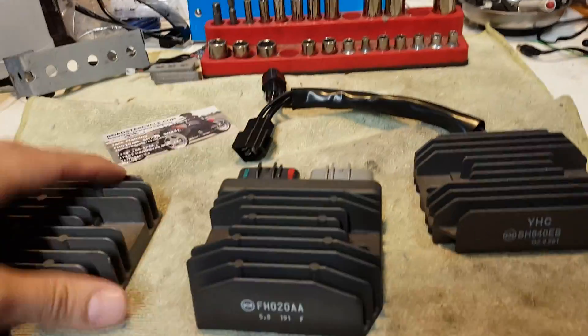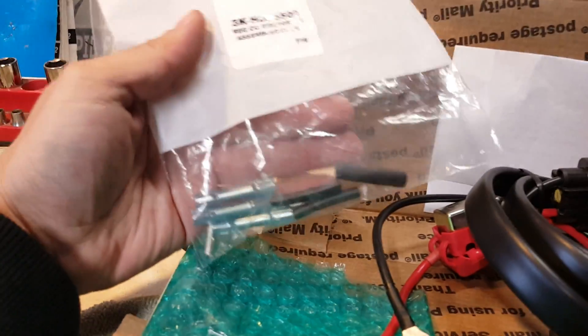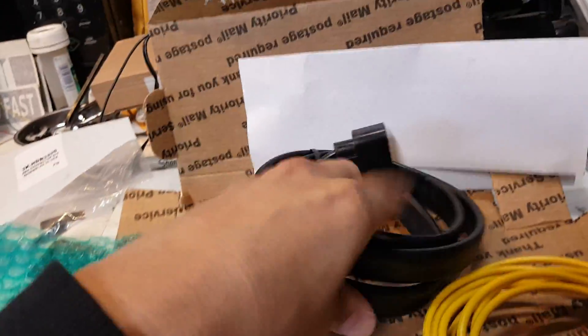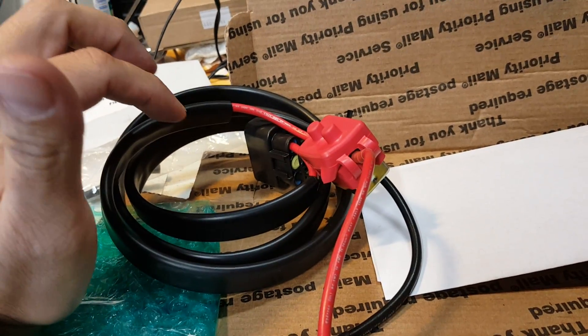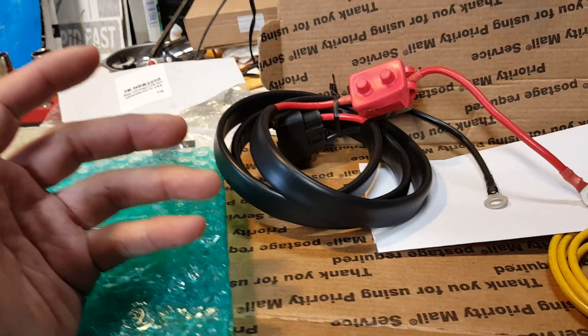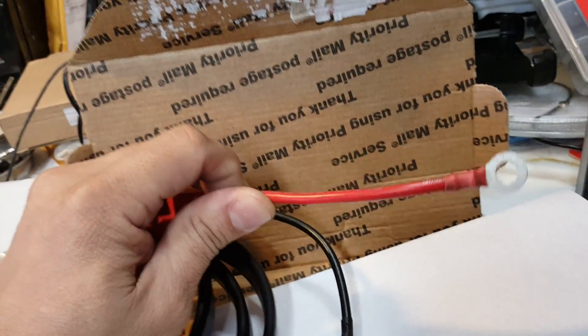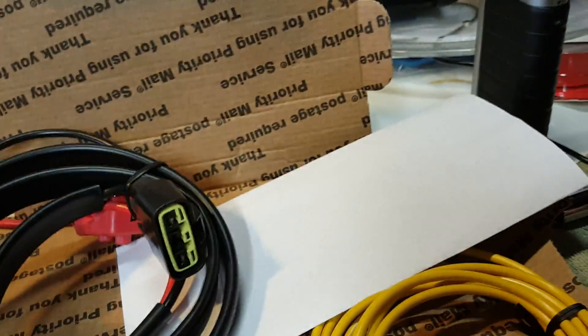With a little more money you get a little better quality, and hopefully the same holds true for the internals. Looking at the super kit contents: you get a package of crimp connections, solder-in connections, and heat shrink. The unit comes wrapped in bubble wrap for protection. The cabling quality is excellent — it's 12 gauge wiring. I had previously upgraded to 12 gauge in my bike because the stock 14 to 16 gauge wiring was melting under the voltage load.